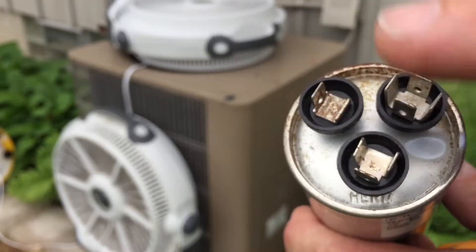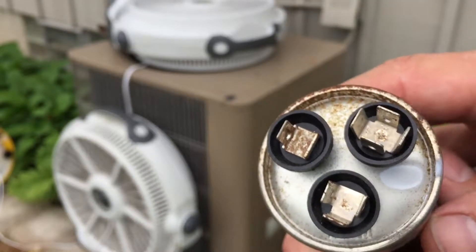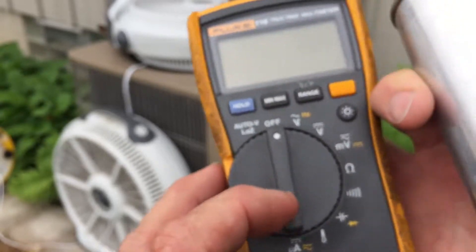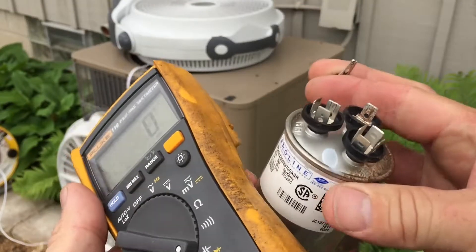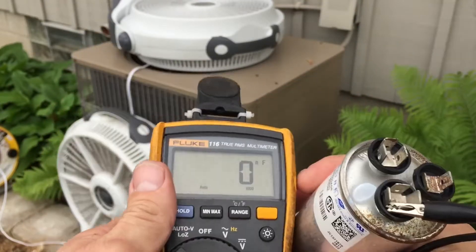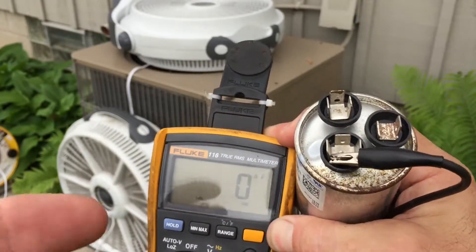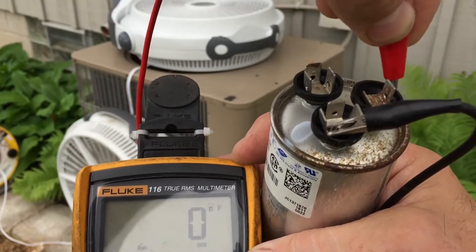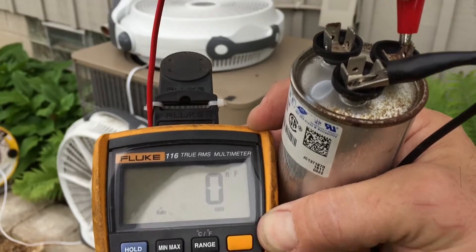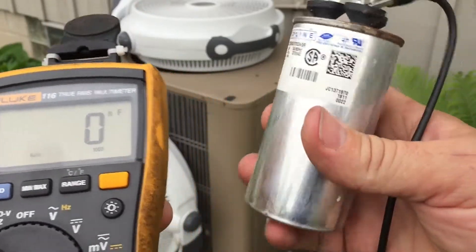All I have to do is reconnect the wires of the new capacitor. The way I checked this to make sure the capacitor was bad is I turned the meter to the setting — the black one goes to the common. Any one of these should give me a reading. No reading. And this one, no reading. So this capacitor is dead.